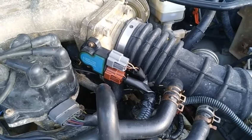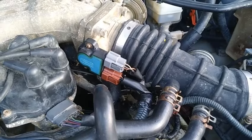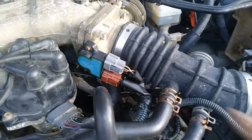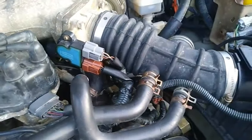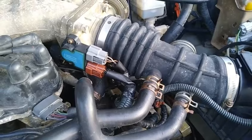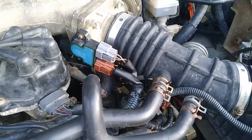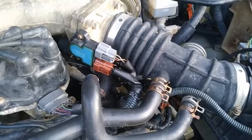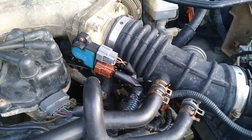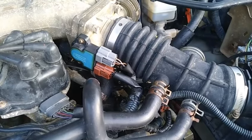The signal idle position of the throttle valve is determined by the ECM receiving the signal from the throttle position sensor. The sensor controls engine operation such as fuel cut. The wide open and closed throttle position switch built into the TPS unit is not used for engine control. Note: if DTC P0121 is displayed with DTC code P0510, first perform the troubleshoot diagnostic for DTC P0510.